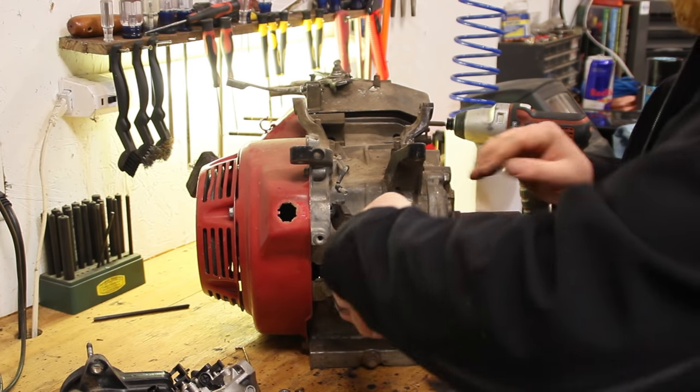I got the top cut off of that arm that works in series with the governor. Now I'm going to pull this around so I can get the crank weights out of the way, and now I should be able to slide this thing all the way out. Got that arm out. Make sure you grab this washer that's left on top - don't leave it in there because if it got in between those gears, boom bam you ruin your engine. Go Power Sports, brand new order, mom and dad's money gone. I'm doing a good real thorough inspection to make sure I got everything out.